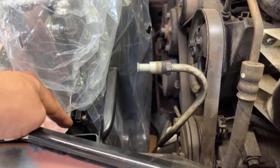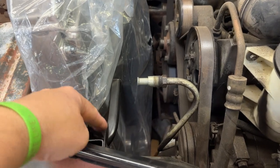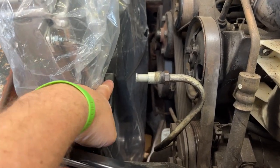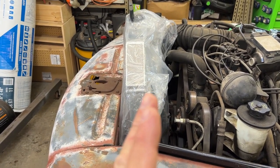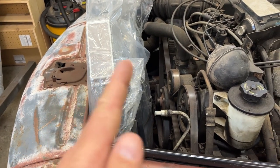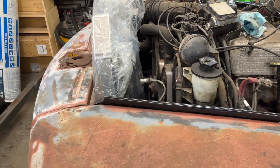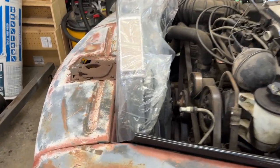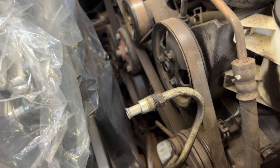What I had to do is — this is the radiator core support U that goes all the way around and holds the radiator in place. It's actually backwards. This little brace that you see here used to be up in the front and the radiator used to tilt kind of backwards. Well, it wouldn't fit if I had this flipped around the other way, the radiator tilting backwards — it would actually be hitting that pulley, that fan hit the pulley. So I had to give myself some space, flip the support around, tip the radiator forward, and actually cut that brace out. You can see it's cut off — that used to go straight across. It hits the fan if it's not cut out.